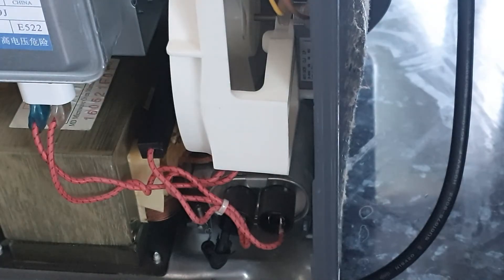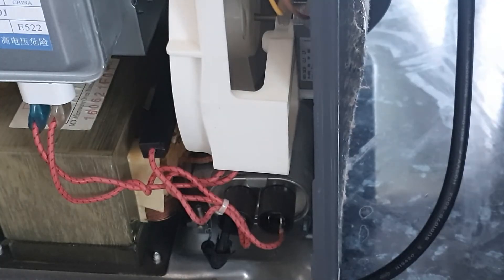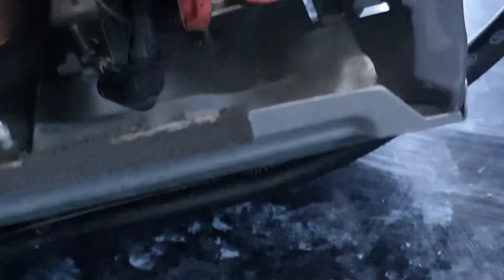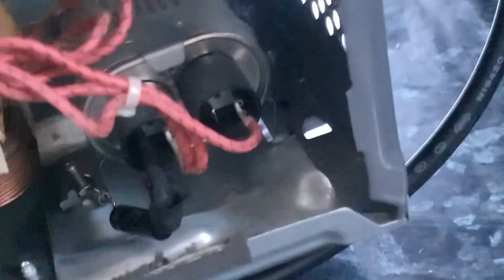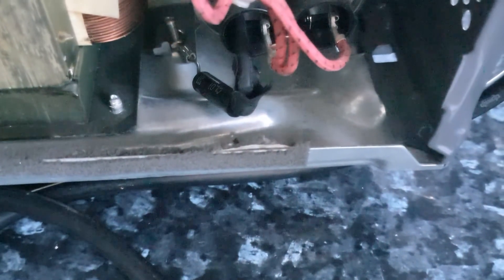Number three is the fault you won't be able to fix: if your main magnetron has gone. So if you've replaced the diode and replaced the fuse and it's still not working, the likelihood is the main magnetron mechanism of your microwave is gone, and at that point there is no real use in repairing it. These are CL01-12 diodes used in microwaves — they're readily available. It cost me £2.50 for a new diode and a new fuse, so extremely inexpensive compared to buying a new microwave, and extremely easy to fit.